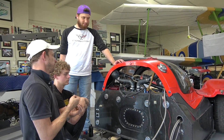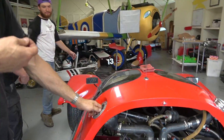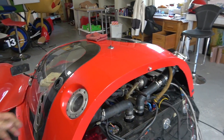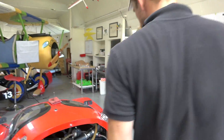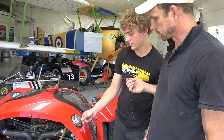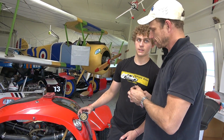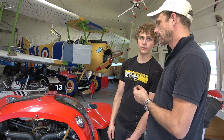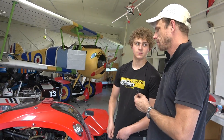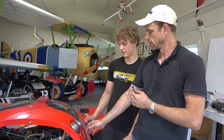One other modification from the original is a dry brake — this is the typical racing dry brake where you put a big orifice in it and can refuel quickly. What modification did you do and why? We replaced it with a Cobra Le Mans style or Monza style fuel cap — just like an old school fuel cap. A lot of people are going to cringe. We did it because it's much easier to actually use. Those dry brakes are a pain in the butt unless you have the big fuel fill equipment. If you're just vintage racing and doing sportsman stuff, you can open it up and put in whatever you need. And of course, all this bolts in so we could put the dry brake back in.